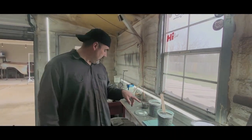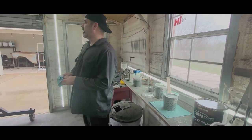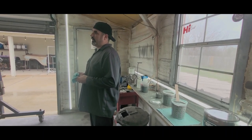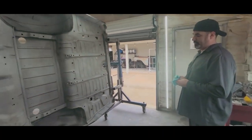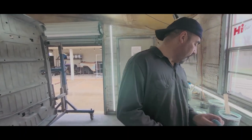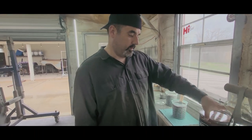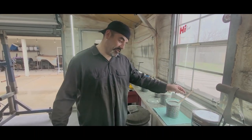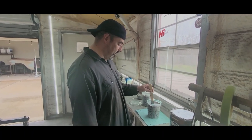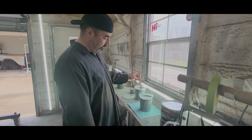But yeah, I guess we're about ready to spray, man. We got two, almost 3 quarts. I think that'll get us through. I remember on the '64, I sprayed two quarts, and I got like two coats on the floor. We got plenty. We're still going to have to take the quarters down and the doors and all that, so we still have about half a gallon here or more. But we don't have a roof. Save material on that. Although, I don't know what's more expensive, bodywork and a roof or buying a convertible top. It's definitely less labor. So, like I say, it mixes 1-to-1.